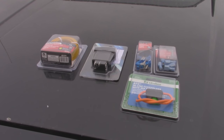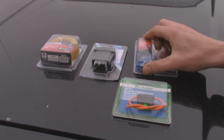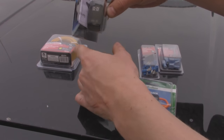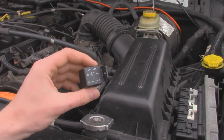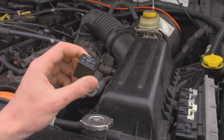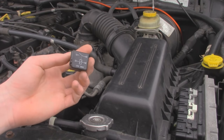Now the way we're going to wire this one in today, we're actually going to leave the factory wire harness intact so that it still turns on when the AC comes on and the temperature gets up in the engine. We're basically just going to tap this in so that we can turn it on whenever we want and still have the factory option. So some things we have for our install: we got a fuse holder, about 30 amp, a few spade connectors, a fan override rocker switch with cooling fans, some 14 gauge wire, and a relay — any 30 or 40 amp relay will work. I have a 30 amp relay here and it should do just fine.